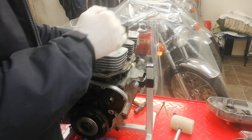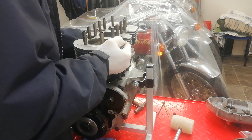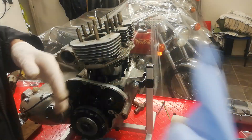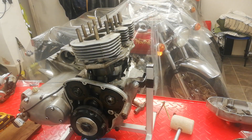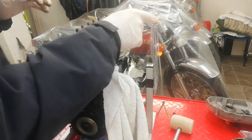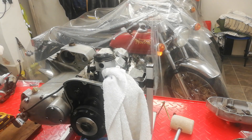We've got the pistons on — they're going to protect the pistons and help stop too much damage occurring to the conrods against the lip of the crank cases. I am going to pack this end one because that's going to catch. This is a triple engine so it's a 120-degree crank, meaning the pistons are at 120-degree angles — one's at 120, one at 240, one at 360 degrees around. And there we go — barrels are off.